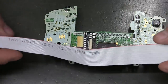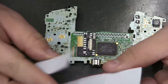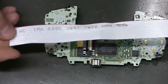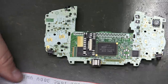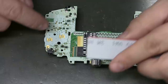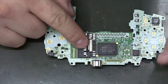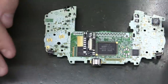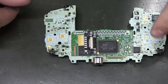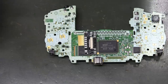Originally, we were going to send ribbon cable along with the kit. I believe this is 19 conductors. Is that what you need? I can't remember now. So you might need 19 wires, but I've got Kynar wire on order, which is a solid core wire, which is a little easier to do small stuff with. And since you're just going to this board with these wires, once it's installed, they're not going to move. So solid will last just fine. You want the multi-strand if there's any kind of movement, but there's not.